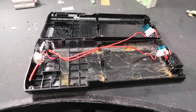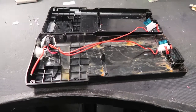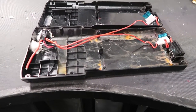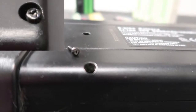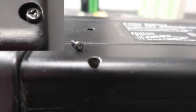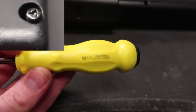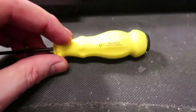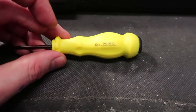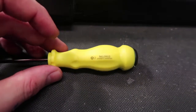I get so many batteries where the customer complains — it was so expensive, why didn't it last longer? I try to explain that they used poor quality cells. About the screws on this case: they are triangle-shaped, a special anti-tamper screw head, so you need special tools to open it. The triangle ones are 2.5 millimeters — a little big but it works. The optimal size is 2 millimeters, though 2.1 or 2.2 millimeters would also work fine to open this case.